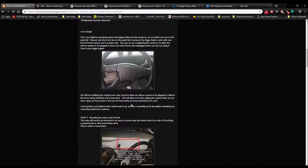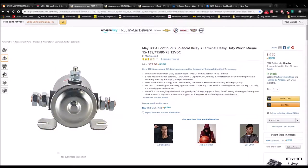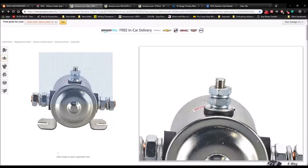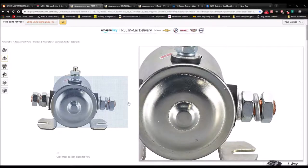Next, we're going to mount this relay. This is an old-school starter solenoid slash relay that General Motors — and Ford — have used for many, many years. It can hold up to 200 amps. We're not remotely using 200 amps, but it's a heavy-duty relay and we need to worry about melting wires. There's your trigger post — that's going to come from the horn circuit output under the fuse box. One large post goes to your nitrous solenoid, the other comes from the battery. Best place to get battery power is from the alternator box, because the alternator charges directly to that terminal.